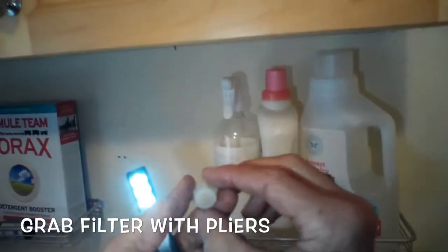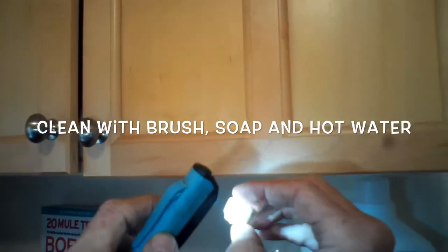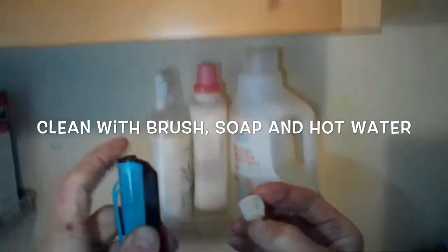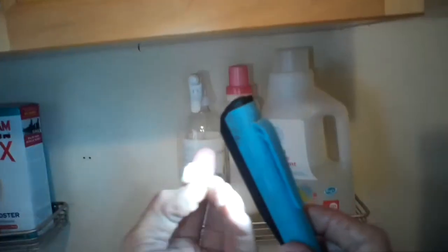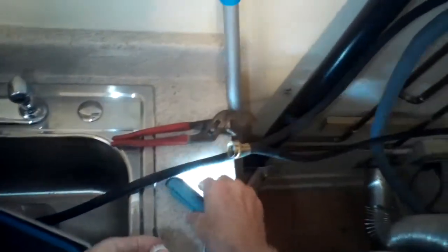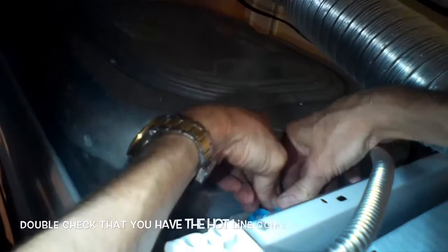When I looked at it, I noticed there was a lot of waxy, globular junk blocking probably 20% of the filter surface. I don't know what that stuff was — something that came in from the water supply. I used a toothbrush, some liquid soap, and hot water and just scrubbed it really good, got it super clean, and did the same thing on the hot side. I think in this case the F20 was caused by just this cold side filter being really dirty.